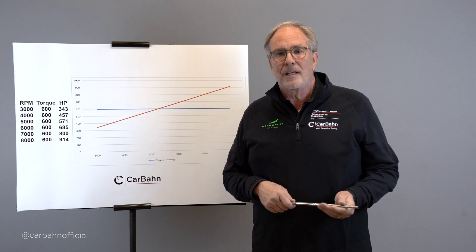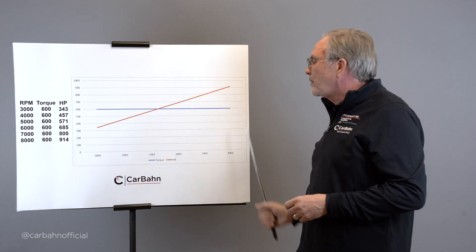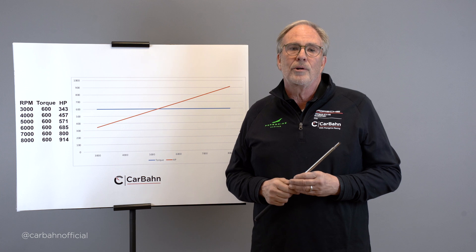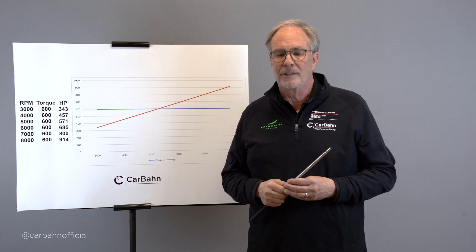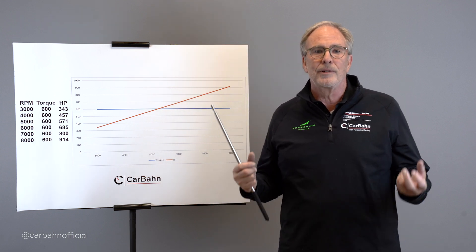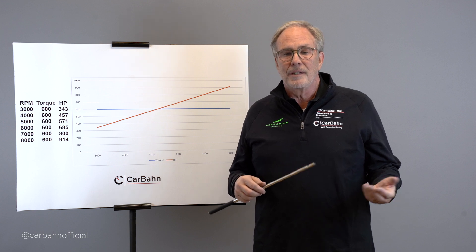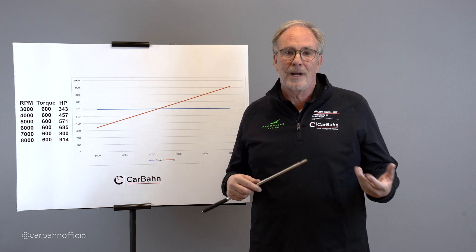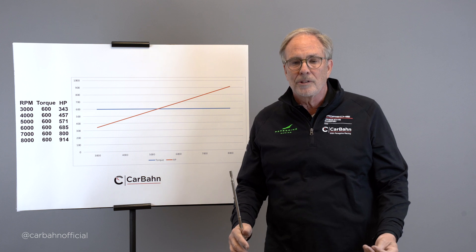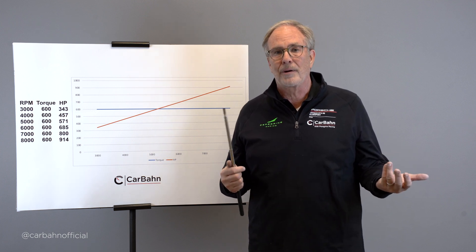The aftermarket tends to just make whatever torque they can, resulting in a power graph with a huge torque bump that falls off badly at high RPM. This causes a couple of problems. First, the increased twisting force can break the entire drivetrain — engine, gearbox, clutch, driveshafts, differential, and even the rubber mounts or unibody mounts. Second, you hit the traction limit, the car breaks traction and loses forward momentum, then gets past the torque spike, and the torque falls off so fast the car feels like it slows down. Not a pleasant power delivery at all.